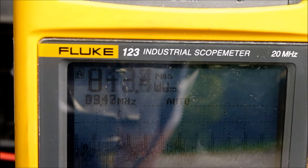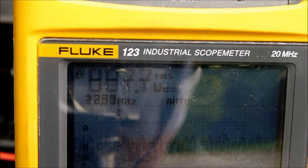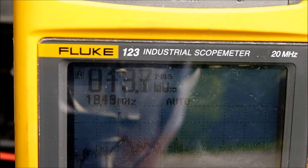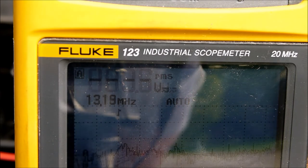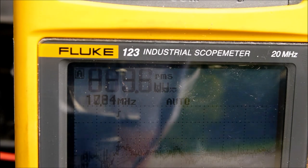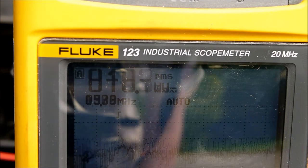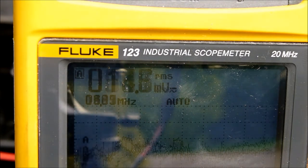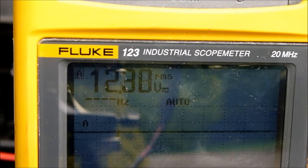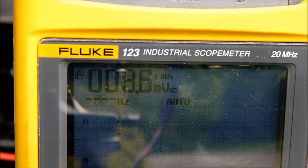Okay, guys, you can see the meter there bobbling around on the millivolt range. I'm going to press the glow plug button in now on my car, or in your case, turn the ignition on, and you should see the glow plugs come on for around 15 seconds and go off again. They won't come on for 15 seconds in my case, because my car is wired to a simple button on the dashboard, but you should see the rail come live. So watch and see. You may even hear the glow plug relay click as well. That's on. And off again.